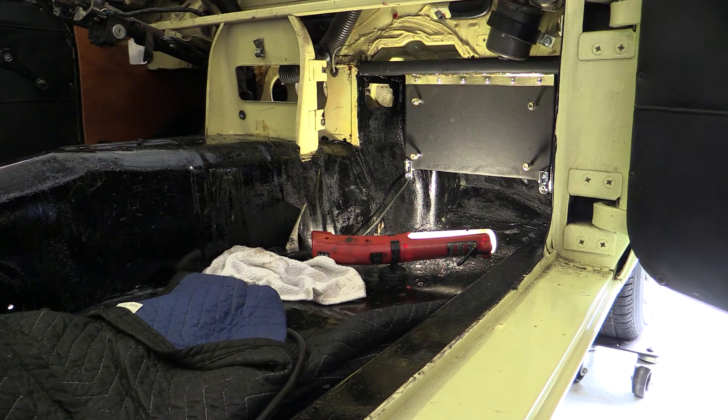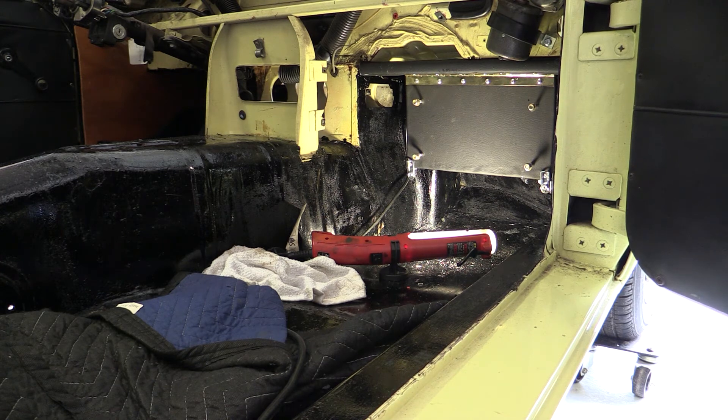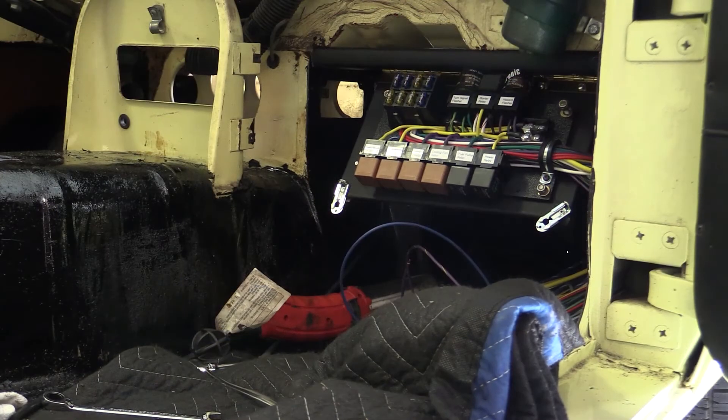Here's the flap in place — it seems to work okay. Now all that remains is to get down into that wheel well and attach the pegs to the forward piece to secure it in place. Then we can put the fuse panel on and start to run the wires for the instrument panel and out into the engine bay for the lights, starter, and all of the other accoutrements. We get the pegs in and now we're installing the new electrical panel — it's a fairly comprehensive system, with a lot more circuit protection than the old one allowed.